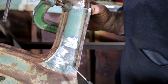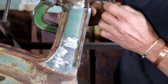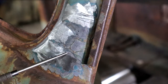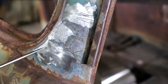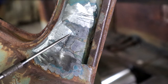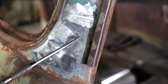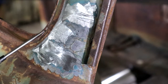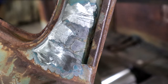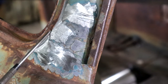So I've got to make a pie cut here in this section, to move this A-pillar that way a little bit. But this lead here — I knew this was going to happen. There's bare metal up there, and from there all the way down to here you can see it's been filled in with lead. So obviously there was a weld seam here, and back in the day this was filled out with lead. And this is right in the spot where I actually would like to cut it.